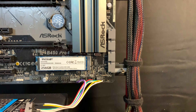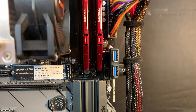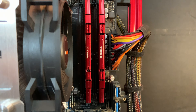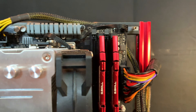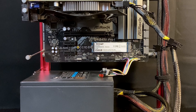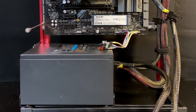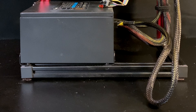If I ran the cables in back, I wouldn't be able to lay the case down flat on the felt strips. Since the AMD Athlon 3000G processor has built-in graphics, I needed only those two power cables for operating the test PC. If I have a video card that requires PCIe power, I can plug in the PCIe cable. For working with SATA drives, I can plug in the power and data cable.